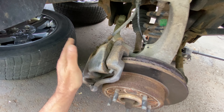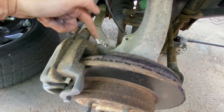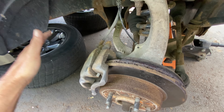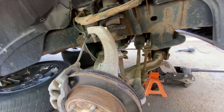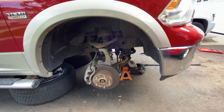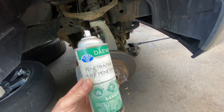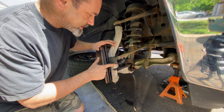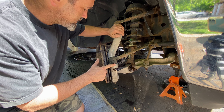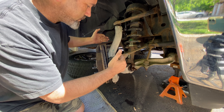In order to get that out, you need to disconnect this because everything's compressed that way. You want to disconnect that, disconnect your tie rod, disconnect the anti-sway bar link. We also want to remove this ABS sensor wire just so we don't stretch that — just unclip it and move it to the side. We also need to take the brake caliper and housing off: two bolts at the back, one there and one at the bottom. Pull that out and make sure you tie it up somewhere — you don't want to be stretching your brake cable.